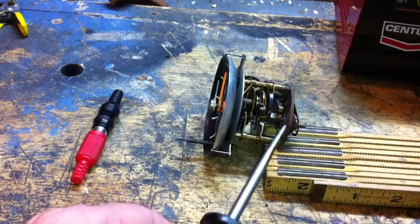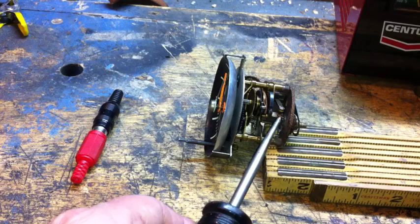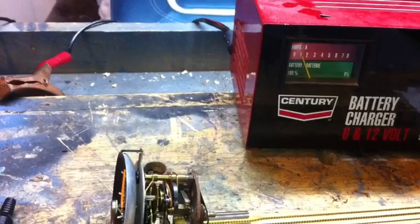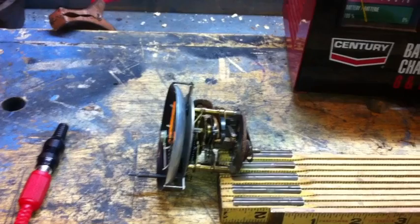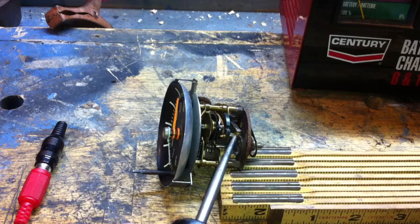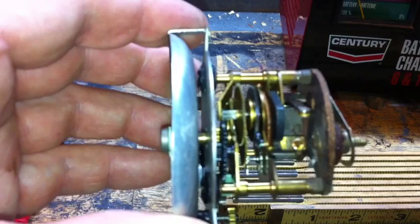Here are the points on the back after you take it out of the little housing and out of the console. This is what you're left with. I took the DC electricity off, just took it up to a little 12 volt. See the points have closed now — I'm going to pull them down manually just to show you what it does when the electricity is hooked up. And you can see back there in the back the gears, the little escape mechanism working.